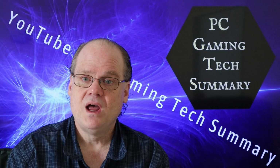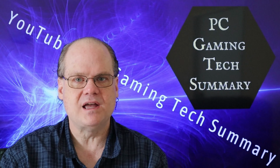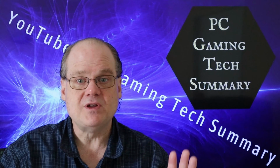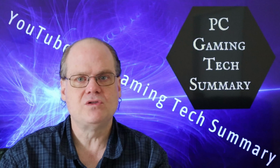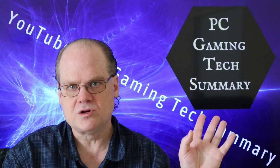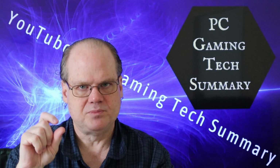And also, we've got 8 cores, right? These are the performance cores, the P cores. I've got 3 of those cores that I consider hot cores, so sometimes I have them at a lower frequency than the other 5. The efficient cores, there are 4 of those with 1 thread each. The performance cores are 2 threads each. The efficient cores are smaller, like laptop-type cores.